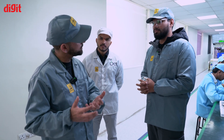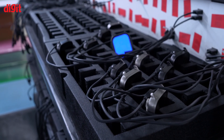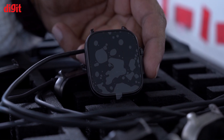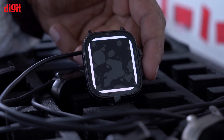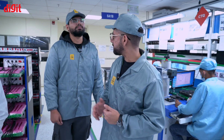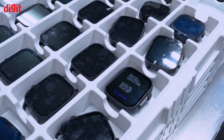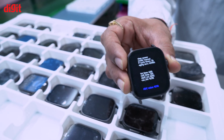Some tests are done on a batch basis as well, but for every stringent quality check — RF testing, battery testing, connection testing — it's done on each and every watch. The aging test corresponds to days of real-world use. Eight hours of aging is equivalent to more than days of actual use, giving reliability that the watch will work for days and months. The stewing test is the same but done without the charger plugged in — total time is 600 minutes, that is 10 hours, with 290 minutes remaining shown on screen.